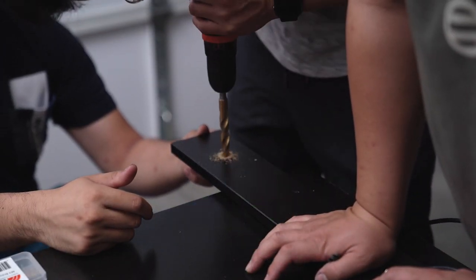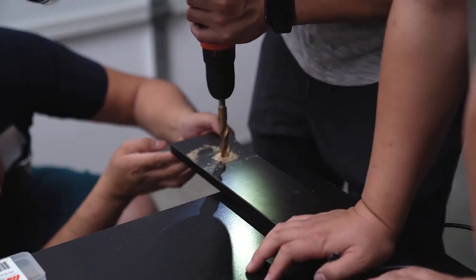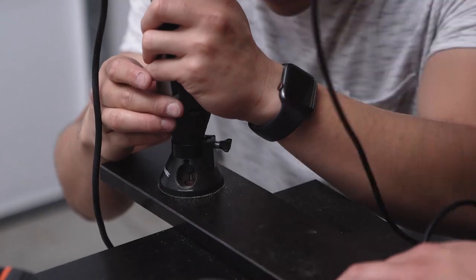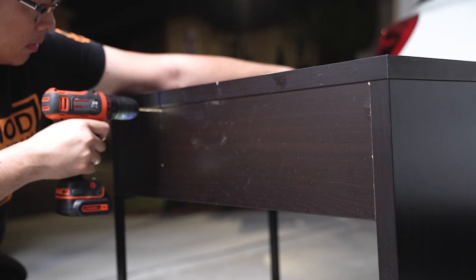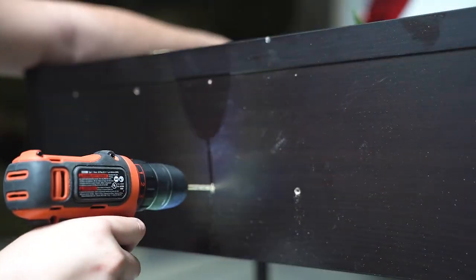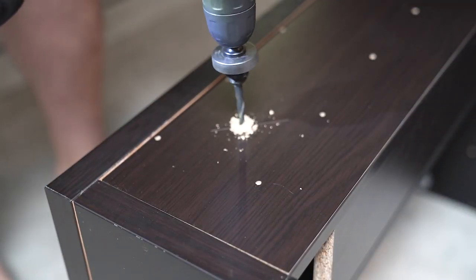Larry and Tim used a half-inch drill bit to create the hole for the power button, but the power button was slightly larger than the largest drill bit we had. Once the hole was created, they used the Dremel to widen it until the button fit. Using the 120mm fan filters as a reference, I drilled the screw mounting holes in each corner and cut two intersecting diagonal lines to find the center of the fan hole.